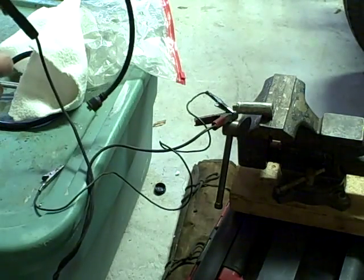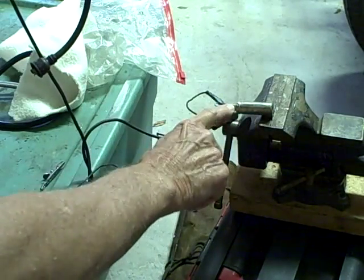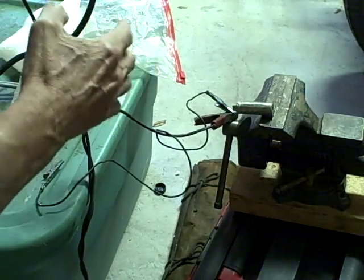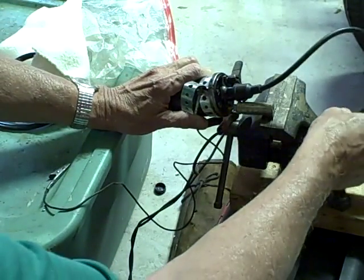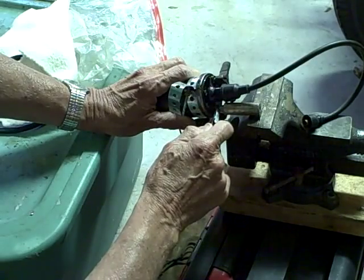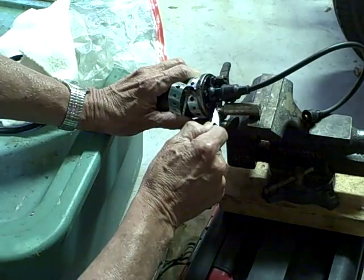The clue here is you have to have a condenser in the circuit. Now I have a condenser that's grounded. This has to connect to the positive terminal on the coil, and that's how it works in the car. If I connect that to that, and now I put power to this — I get a good spark.